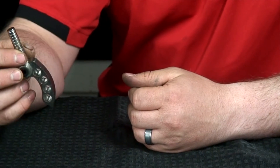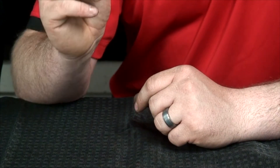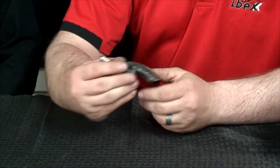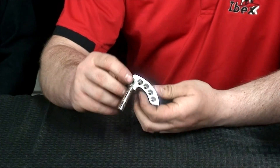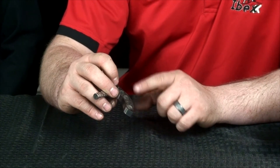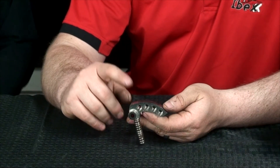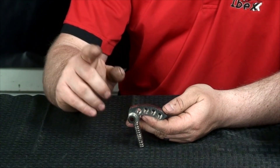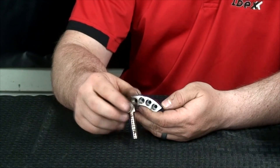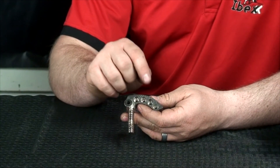One of the things I'd like to go into is how we adjust these and which holes to use, because I know everybody wants to know which hole do I put the magnets in. As a rule of thumb, normally speaking, we try to fill the heel first and work our way out to the tip. That is a quick, easy rule of thumb — it is not the end-all be-all. You need to understand that these four holes — or two holes on a Can-Am — are speed-related. This particular hole adjusts your engagement to about 20 miles per hour, this hole from 20 to about 40, 40 to 60, 60 up. These are rules of thumb, not hard set rules of science.